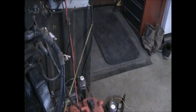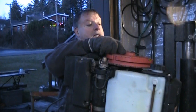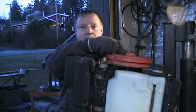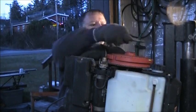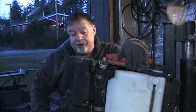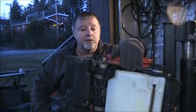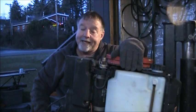Yeah. I'll get it all straightened out. But, well, that's as far as I'm going to go with this one right now. Before I even probably try and fire it, I'll at least blow it off with some compressed air, clean it up a little bit, and put a little more oil in the VRO, that kind of thing. So, but she looks like she's going to be a runner. It's got good compression, good spark. Key switch works, starter works. I'll be happy to come get it out your backyard upside down on its head, you understand?